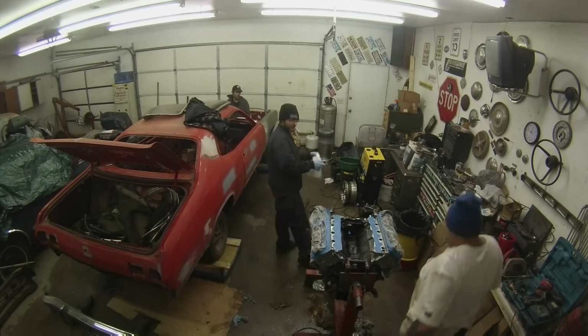In this time lapse, they clean up that engine to paint it, and like I said, it'll be going in his 85 Town Car. It came out of a running, driving 2005 Crown Vic Police Interceptor, and we got the engine, transmission, rear. He's not using the rear axle, but he's using the disc brakes off it, and I think he's using the 3.23 gears out of it.